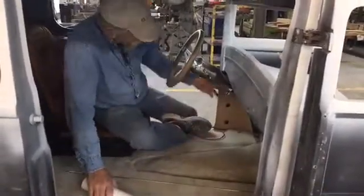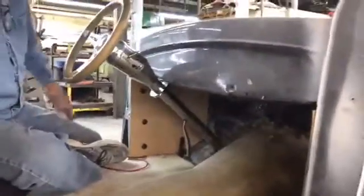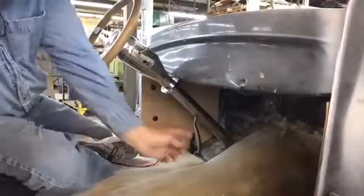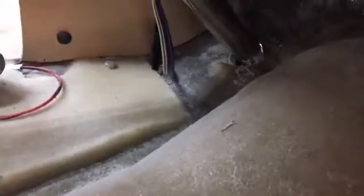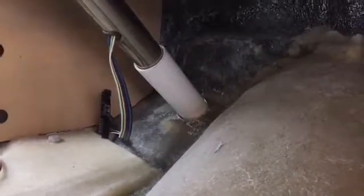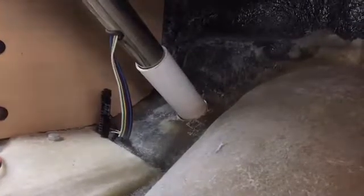I like my angle. I've got my column drop just tacked on here to make sure that Larry likes the height of this and everything, so we can mount that steering drop or column drop permanently a little later. You can kind of see I've got a hole in the floor there. Lots of room. I'm going to poke up through here. So why don't you stay there, Josh, for right now. You can see that through there. Yep. And once I get that, I can bed that in and pull the column out, and I'll grind that off even with the floor, and then come look at it out here on the firewall.